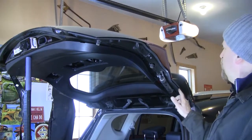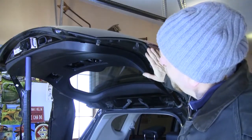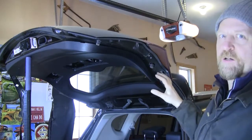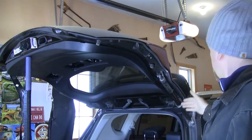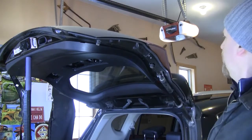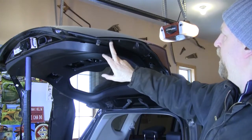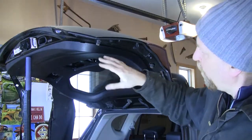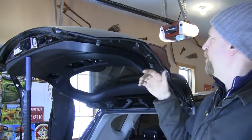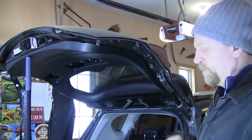To start, we've got to remove this trim piece right here. There's also a sensor in here — actually, it might be a warmer that helps keep the liftgate from sticking closed, heating up a little strip so ice doesn't form. We need to get all that off first so we can get at the bracketry. There are two types of fasteners: a 10mm headed bolt — about four of those — and a couple of plastic clips, which are just there to speed up assembly. The whole piece will just snap down and we can leave those clips in the trim piece.